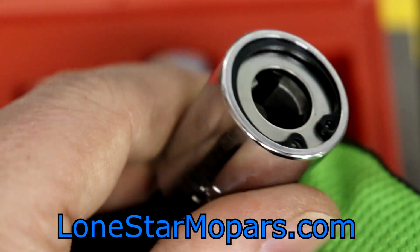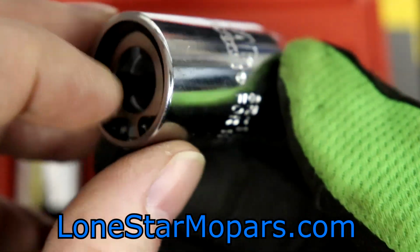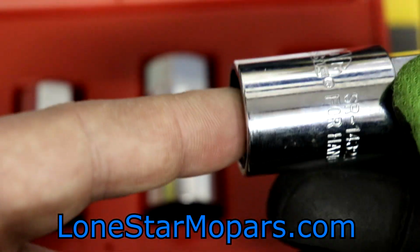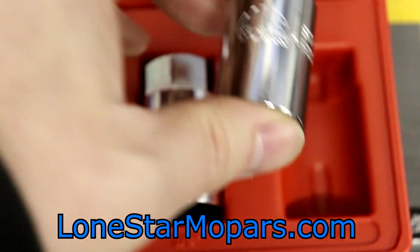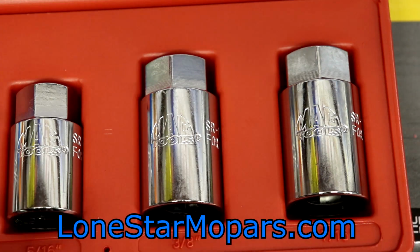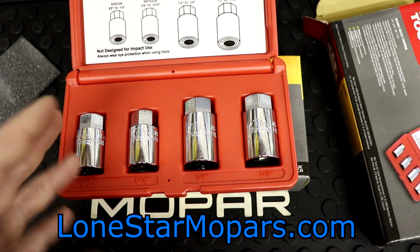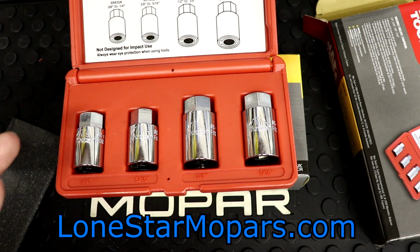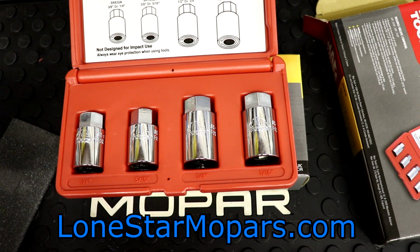So there's a lot of witchcraft happening in here, even underneath that snap ring. But essentially, once you get in there and you start turning this, it's going to sort of finger trap, right? And I think, if I remember correctly, my dealer did tell me that they had a better iteration of a stud puller, and that these will work, but it's going to mangle your stud. That's typically what you're going to have happen.